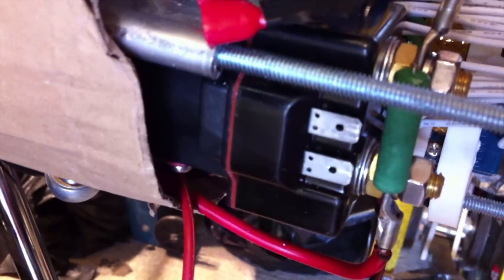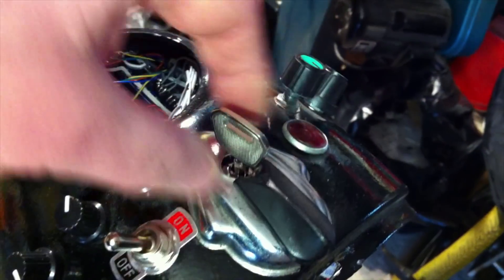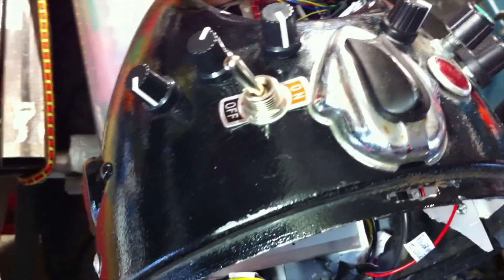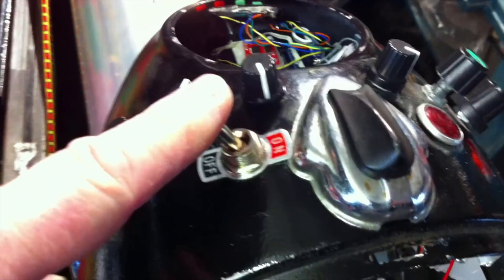On the side here, these are the contacts for the coil of the contactor, which will energize it when I turn the ignition key. The ignition key is one of these normal ones you can buy from electronic shops, and I managed to fit it through the hole that the original Russian key system was mounted through, with a rather cool cover plate over it. Inside, I've got my PID control potentiometers — overall gain, a device for removing the dead spot in the Kelly controller, and an on-off switch. A three-pole single-throw switch turns on the Arduino, which for now runs from a little AA battery pack — I like a separate supply for my balancing software, at least initially.